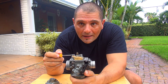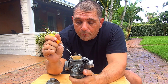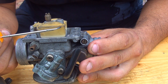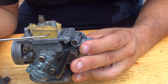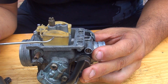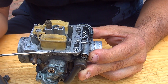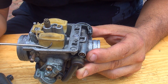Sometimes you might have fuel and oil mixed together because this valve right here is failing to close properly. The way to set the float is really easy — you just have to push a little flap up or down. If you look from the side, the float has a line right here. This line has to be at the same distance from the carburetor body on both sides.